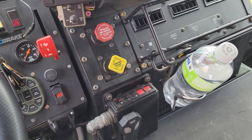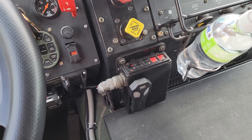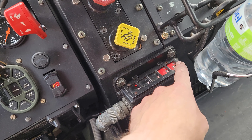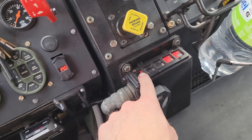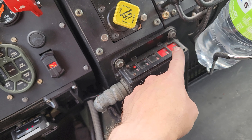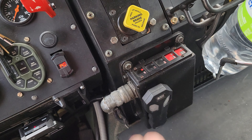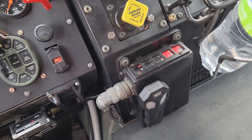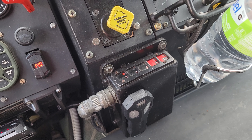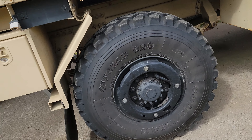That took about 25 minutes at 1,100 rpm to fill these giant 14R20 tires to 85 psi, so it takes a while. One thing you'll notice if you start your truck and all the tires are flat — you're going to have run flat flashing and your highway pressure flashing with it. That's totally normal. It will not go out of run flat mode until you tap highway. I let them inflate almost all the way and then hit highway, and it tops them off after that.